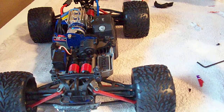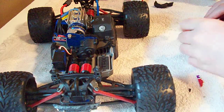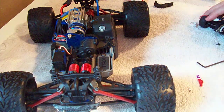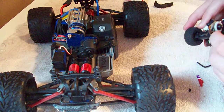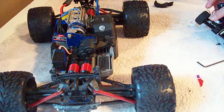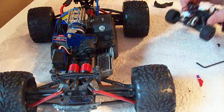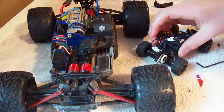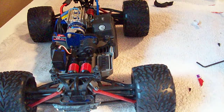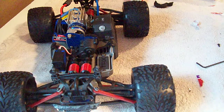With that, you're just going to have to leave your motor mount loose and kind of move it back and forth — it will kind of space itself out. Or you're just going to have to experiment with different positions. If it's set right it will roll back and forth easy, but if it's set too tight it will be really hard to move, and if it's too loose it won't match up with the spur gear. So you'll kind of have to do trial and error on that.